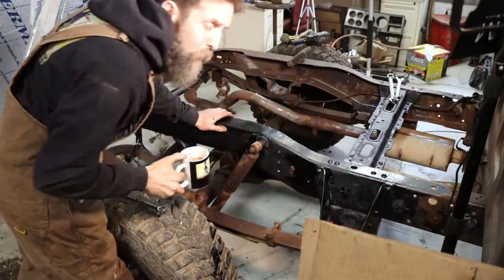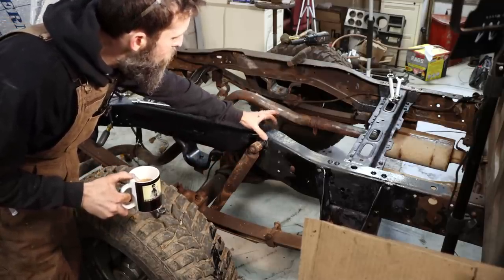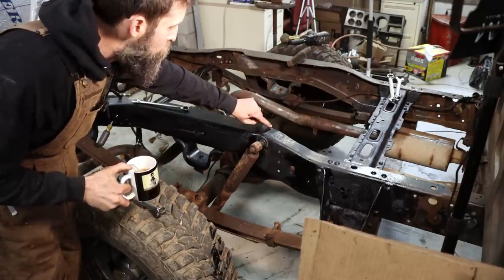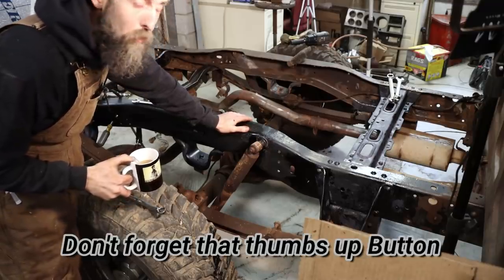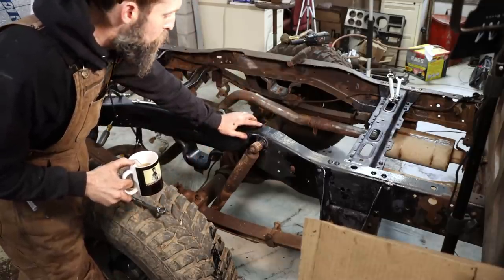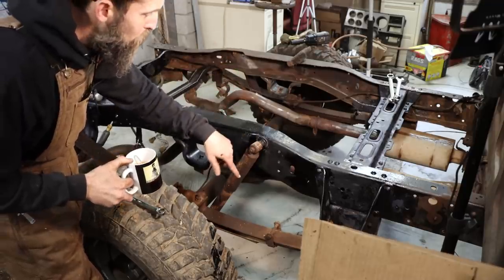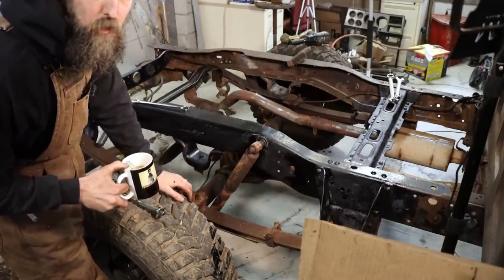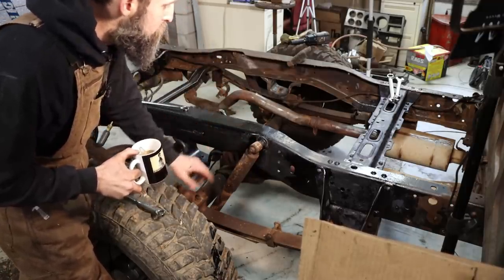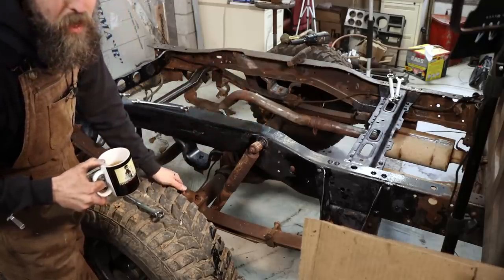So last week I mentioned that we had a crack in the frame back here on the passenger side, right at the top of this shock absorber, and it almost runs completely across this top web of the frame. If you squint real hard, you may be able to see it from there, but I'll bring you in a little closer. I know eyes ain't what they used to be, neither are mine. So we need to clean that out, weld that up, inspect the other side as well. We're not gonna hook these shocks back up. In fact, here soon we're just gonna drop this whole axle, shocks, springs, and push them outside. They'll probably never be cleaned up, and replace them with the extra set of axles and springs that we got. So let's pull this off of here, clean this up, repair that, and maybe inspect the other side for cracks as well, because it was really common for this to happen.